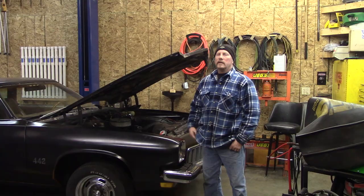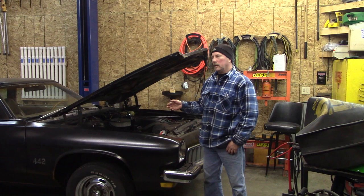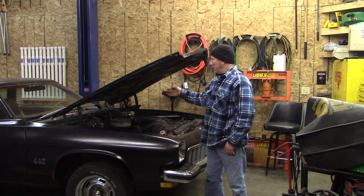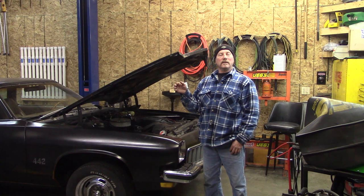After cleaning up the undercarriage and redoing the whole front suspension, we're going to take this engine out. But before that we want to find out why this thing was so doggy. It's got a decent ignition and a decent carburetor, but when we'd be merging onto the freeway this thing couldn't get out of its own way. It cruised and got decent gas mileage, but there was no power. So we want to take a compression test on it.